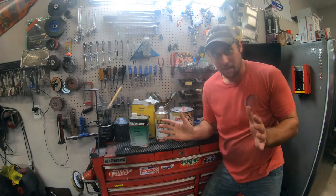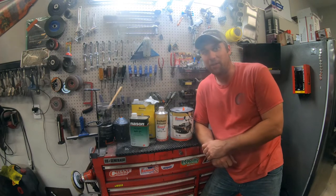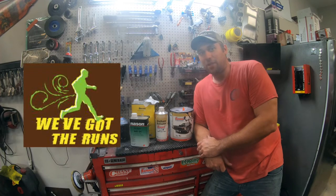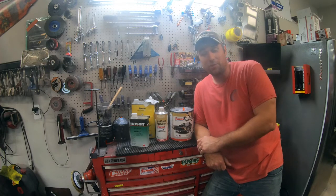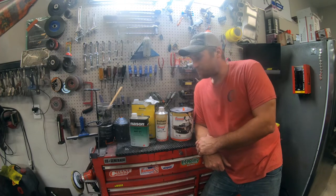Now you need to have yourself a test panel about that long on your piece of cardboard or paper or whatever, and give it a few seconds, see if it runs. You know, adjust your fan pattern, whatever you need to do. I have a piece of cardboard over there that I always use, or, you know, people order enough Amazon stuff nowadays, you always got cardboard sitting around.